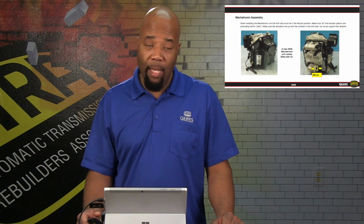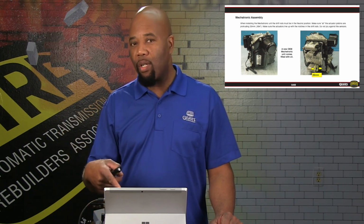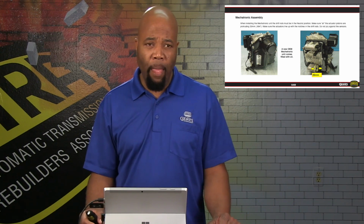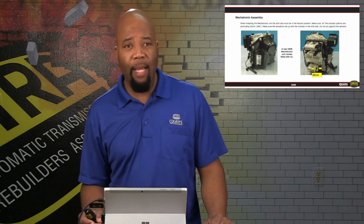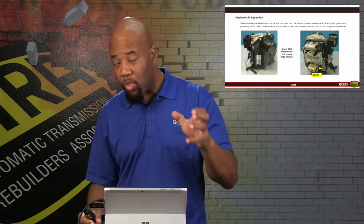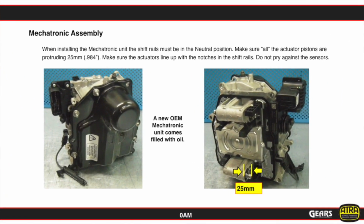accumulator housing. So it doesn't take a lot to drill it. Basically, you're going to be drilling into a gas charged canister. We'll show you a little bit more detail as far as what that accumulator looks like. But you're going to be drilling into a gas charged canister, so you're going to be releasing an inert gas. It's going to be like nitrogen on the back side of that, and the fluid pressure would be on the opposite side of that. So again, the gas charge is going to remain, and that's the concern that you would have as far as the pressure that can be released when you release that cover if there is damage done to the accumulator portion of this.